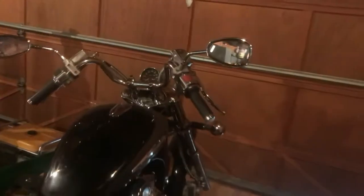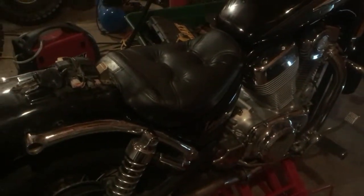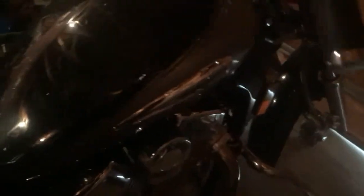Here's the bike. It is a 1987 Suzuki Intruder 1400 and I bought it just before Christmas. I got about 2,000 kilometers on it now. It was running like garbage when I bought it — it was sitting for a long time. I just had to clean the carbs a couple of times. The original fuel tank was all rotted out on the inside, so I got this newer tank off a '92. I don't like the look of it as much as the old school tank, but whatever. The fuel pump didn't seem to be working right either, so I put one of these Mr. Gasket 42S pumps on it for now and it seems to be working better.